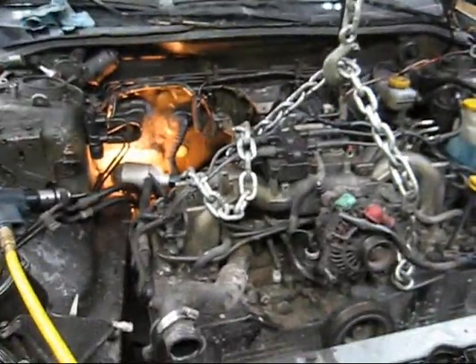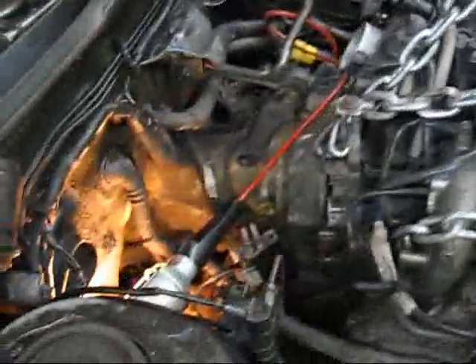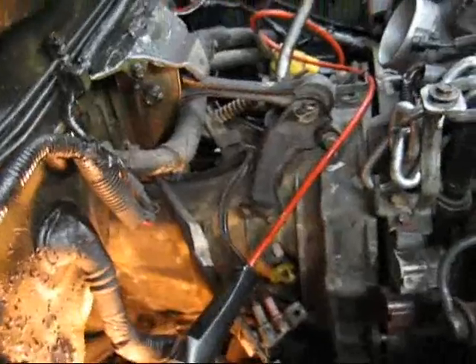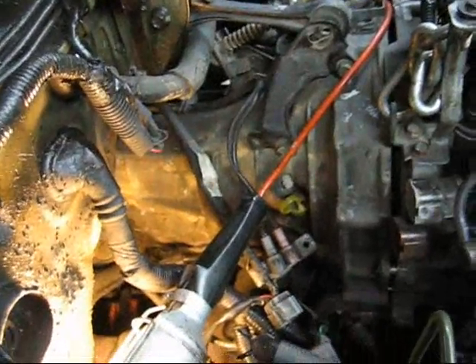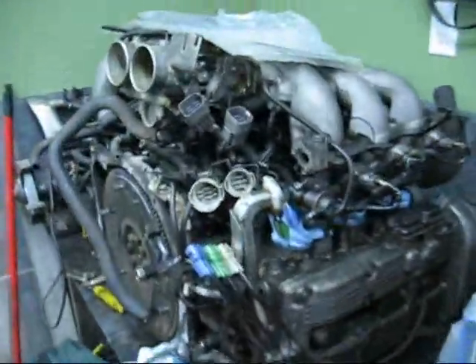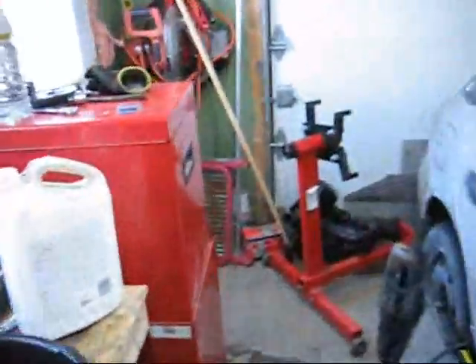I'll find out how much this car weighs compared to the SVX that had this engine in it and we'll do a power-to-weight ratio comparison. The engine is coming out and we're going to pull out this tranny and put in a 5-speed manual. The final drive is not the same — this one is 3.90, which is a dog. They put that in for fuel economy, but the other is a 4.44 final drive. So this thing is going to be howling like a pig on the highway, but be very responsive.